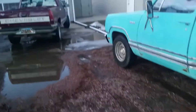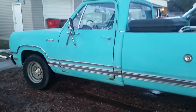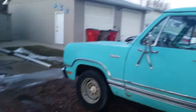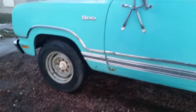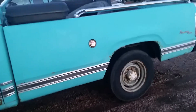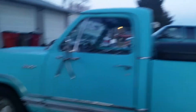Hopefully this summer I'm gonna throw a new carburetor on her. She's running a little rich, and the previous owner put a manual choke on it — it's just a piece of crap, doesn't really work that well. I picked up a new carburetor with the factory choke that goes into the intake. Maybe do a little lowering on her too — I was talking to a guy about flipping the axles, and I know you can put the van lower control arms on the D100s, but I'm not sure about D200s, so I've got to research that. New carb to run better, lower it a bit, and just have a cheap blue old-school daily driver. Alright guys, later!